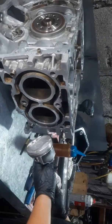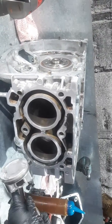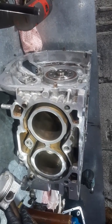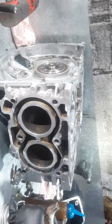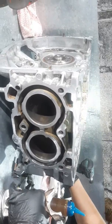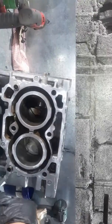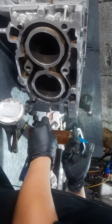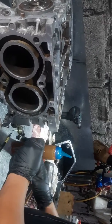We're about to put this last piston into the engine block before we close up the oil sump. We take off the connecting rod caps. For some people, they put a light film of oil, but I prefer to use a light grease film on the bearing caps. Oil or grease — I think it doesn't matter, or you can just put a drop of oil as well.